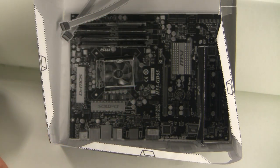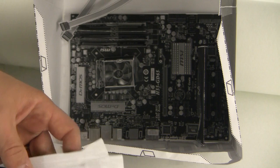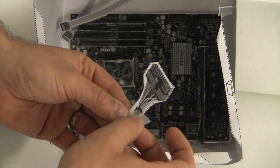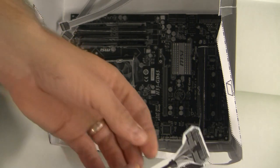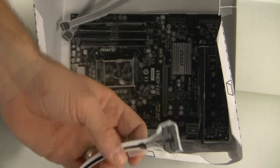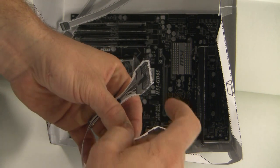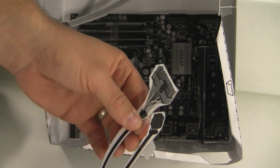I'm going to find the power supply connectors I'm going to use. You can print these out from the instructions — they're fairly straightforward. There are a lot of extra connections, so I'm just going to mark the ones I need with a little piece of tape. This large one is the 20-plus-4 pin connector. And this one is the 4-plus-4 connector — also called an 8-pin connector on the motherboard, since 4 plus 4 makes 8.